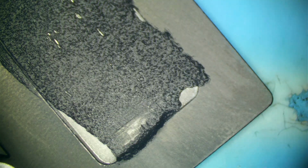Now again, I'm going to show you guys how much thermal compound I'm applying. I don't want the test to be biased in any way to our product or other companies' products. So I'm going to apply a similar amount of paste on here, about as consistent as I can get it, because the syringe openings are a bit different between the two syringes. I'm going to hold this at the same angle, and I am going to squeeze this paste down the center of it. And you can see it kind of picked up there because the stuff is so thick and sticky. But you can see that the spread pattern was more consistent and there are overall fewer air gaps here.